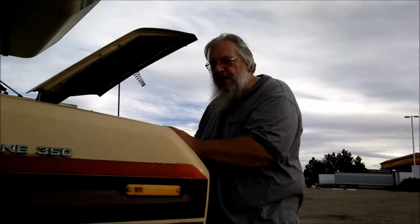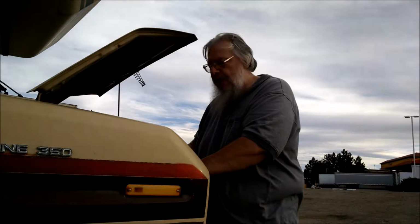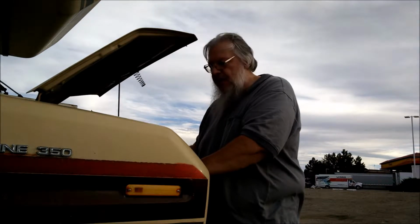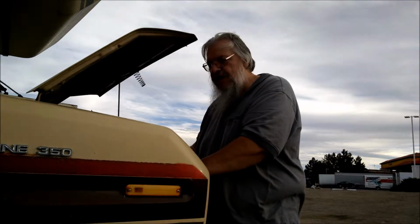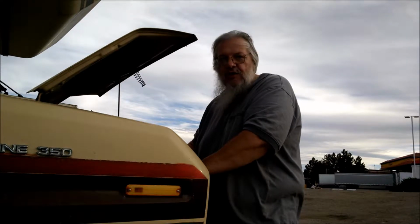I knew it couldn't last forever. I left El Paso with the motor just purring away, got right through New Mexico with no problem at all. Then I got here to Benson, Arizona, got fuel, and it went bad. It turns out the starter solenoid wouldn't shut off. The starter was just constantly running, drawing current. Eventually it shorted out, burned out my battery cable, and of course my battery is probably dead by now.